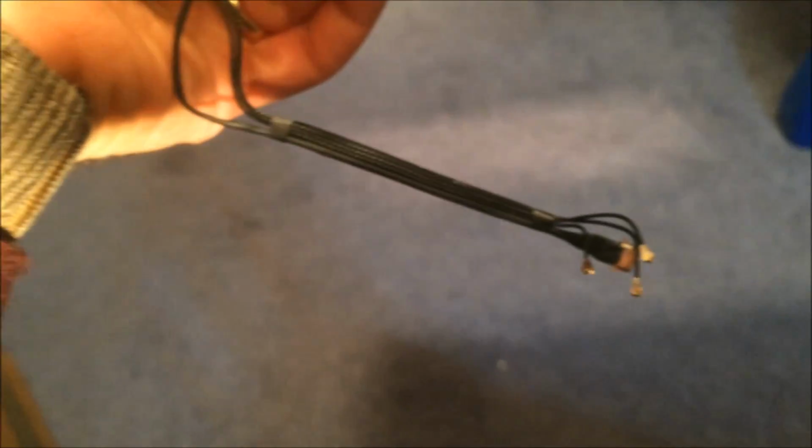And so there you go. You have the one cable on one side, Wi-Fi, and the other cable on that side. So you take your new one. If the hinges are not set at above 90 degrees, I'd recommend carefully getting a pair of pliers and holding it with a firm grip and bending it into place so it's above that 90 degree barrier, or that 90 degree mark. And then carefully, when you bring it back in.